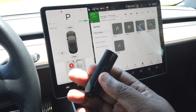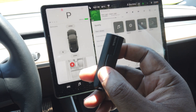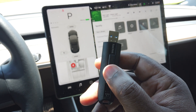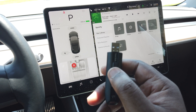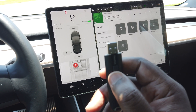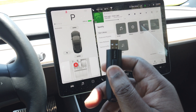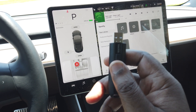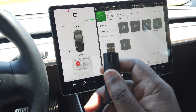I've got my SanDisk opened — here it is, brand new, never used, formatted right out of the box. We're going to go ahead and extend it. The thing you need to do is, if you have anything plugged into your USB ports — even another flash drive, charger, or whatever — take everything out. Remove everything from your two front USB ports, because it can't format anything if there's something already plugged in. So I'm going to put this one drive in, everything else unplugged, and then we'll go to the menu and do it from there.